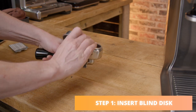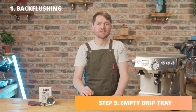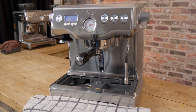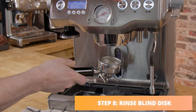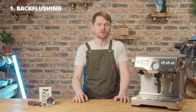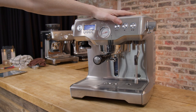To do this, put your blind disc in and add a cleaning tablet. Insert the portafilter, make sure it's properly locked in, and make sure your water tank is full of water and your drip tray is empty. Then press the menu button five times to get to the cleaning cycle and the manual button will illuminate. Press it and go do something else for 370 seconds. You'll see the counter counting down from 370 seconds with a series of back flushes and pauses. Then just rinse the blind disc, give the group a good flush by pulling a few blank shots, put your basket back in, and you're all sorted. You can access the back flush cycle the same way for a water-only back flush, or do it manually by pressing the shot button, letting the pressure ramp up to full pressure, staying there for a couple of seconds before stopping, and repeat four or five times.